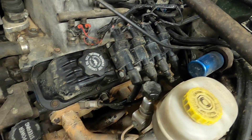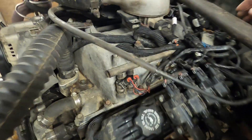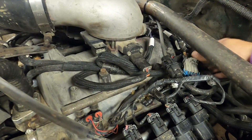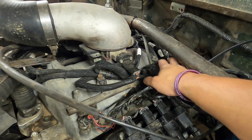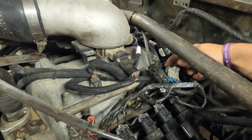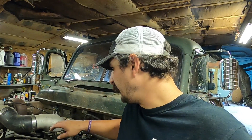There's a sub harness, a base harness, and then a harness in between that doesn't come with the Holley Terminator X kit. That connector on the back side — you need to order a universal coil near plug harness. It comes un-terminated because you have to put it into the Terminator X ECU connector. Holley gives you the exact directions — you just cut them, crimp on new connectors, and put them right in the connector where they say to. It all plugs right in as long as you have those short sub harnesses with your coils, and then you have full ignition.